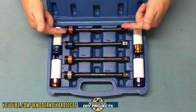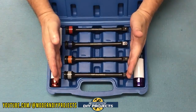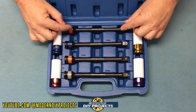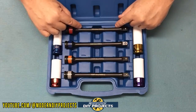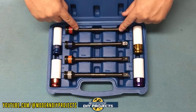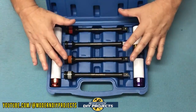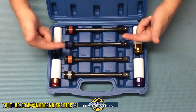You'll notice on these different sticks that each one has a different size to it. They all have a set length that is exactly part of the calibration. If you look at the different ones, the lower-torque one is thinner and it gets a little bit thicker as you go to the higher ones. Each one has a certain thickness or girth to it, and that's how it calibrates exactly how much torque it's going to apply — these hunks of steel are calibrated to have a certain chemistry to them and actually flex a little bit. These are only meant to be used with impact wrenches, either battery or air — they're not meant to be used by hand torquing.